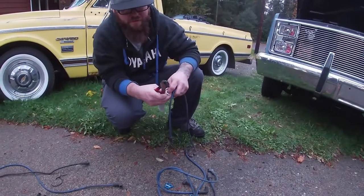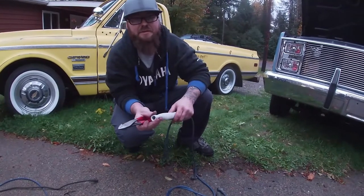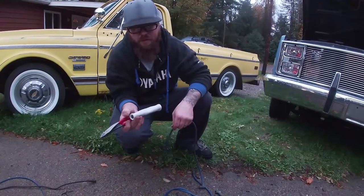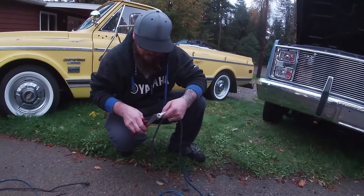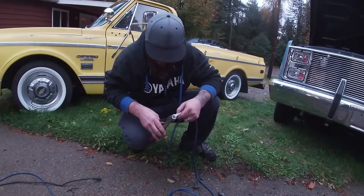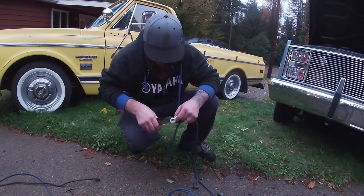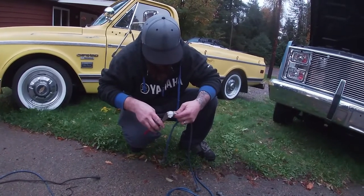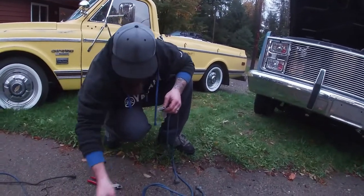What that metal ring does is, these are actually for more of a straight plug wire end, and this will actually go over the end of the spark plug. Getting this 90 boot through there is ridiculous, but since we're not running straight wires because of our headers, we're just gonna cut said ring off. Hey, look at that, it fell right out. Nice. That's what it looks like.